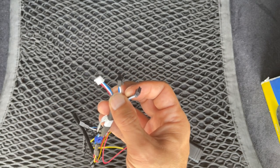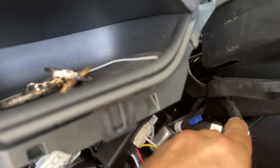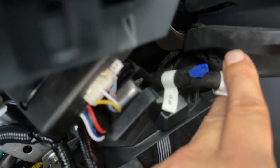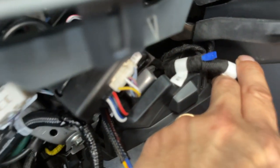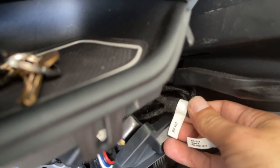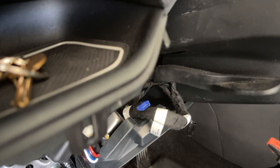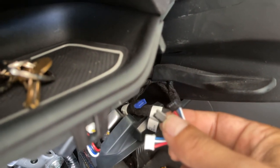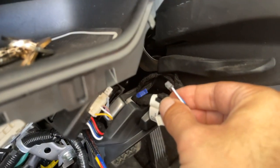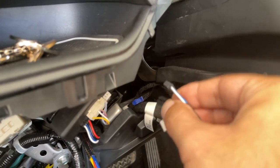Here's the harness from the Startex. The blue connector is what we're looking at, and it's labeled on this side — it says 'RF Kit.' Coming off of the remote module, we're going to use the center black connector and plug it into that blue RF Kit connector. It's a tight spot so I can't set a tripod up, but all we're doing is making that one connection and that's it.